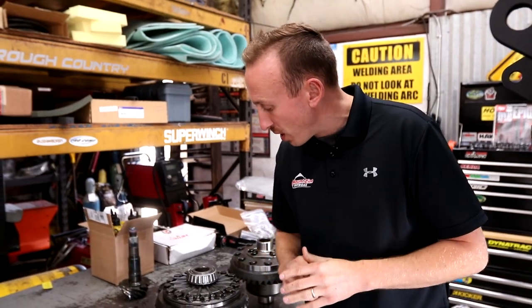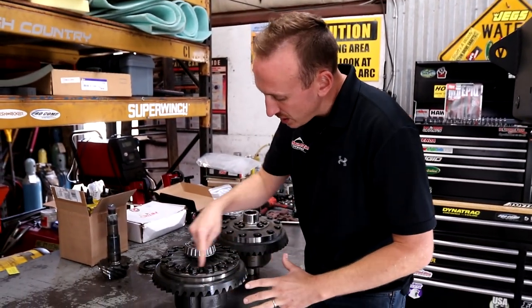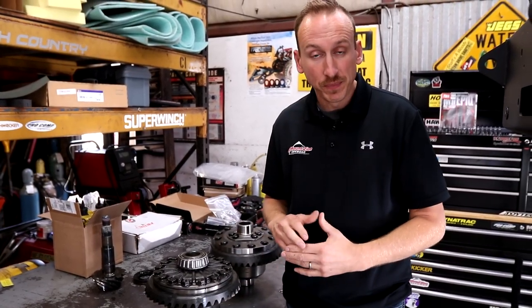The owner actually brought us gears from Nitro Gear and Axle, which make a 4.30 ring and pinion set for this truck. But apparently some of these trucks, I think specifically the dualies that came with the AISIN transmission, had this 16 bolt carrier holding the ring gear on. Unfortunately, at that point, we had to put it all back together and go back to the drawing board.